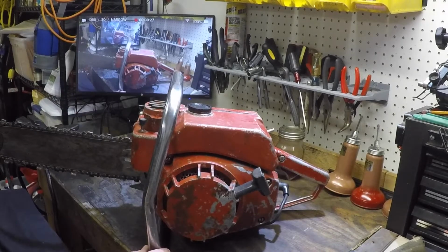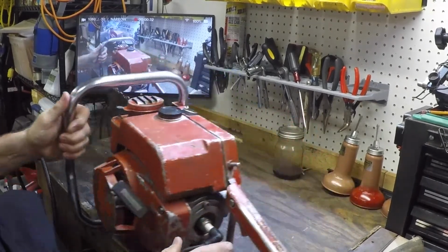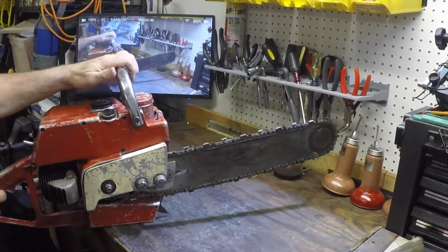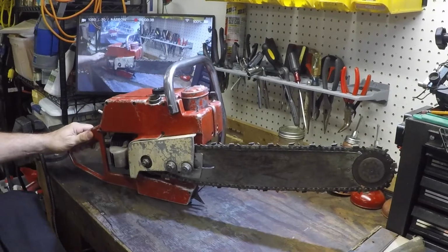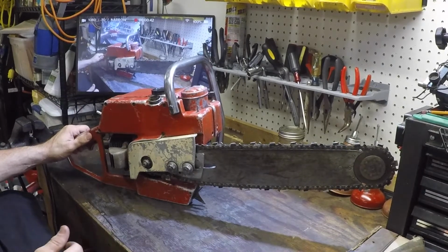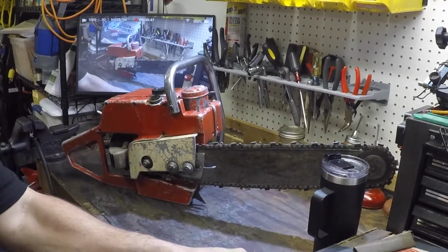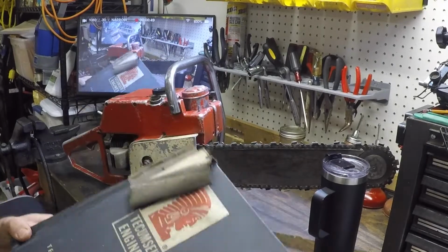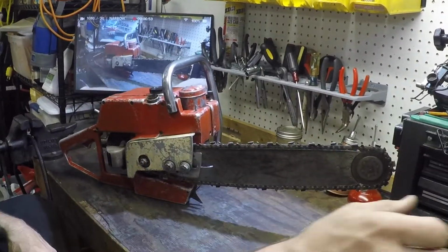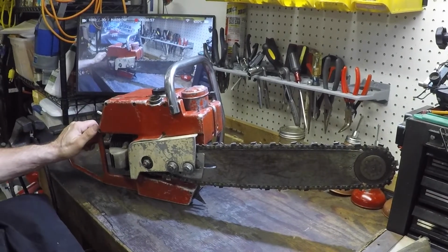But here's what I can figure out so far. It's a Lancaster Pump and Manufacturing model 655. And I believe it has a Tecumseh engine on it. At least that's what the markings say. And consulting the great book of Tecumseh, it puts it at an AH-58 engine, which should put it in the area of about 95 cc's.